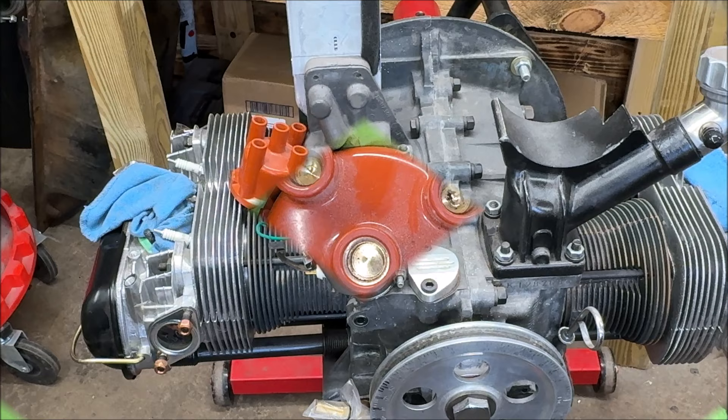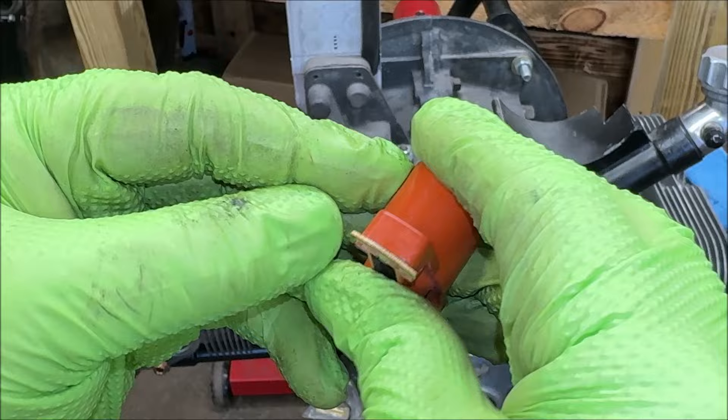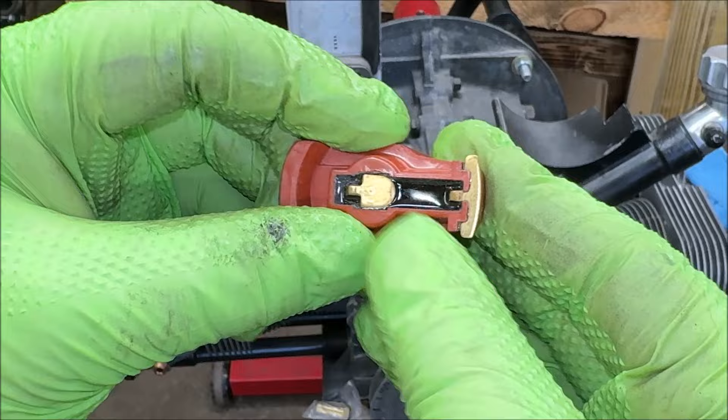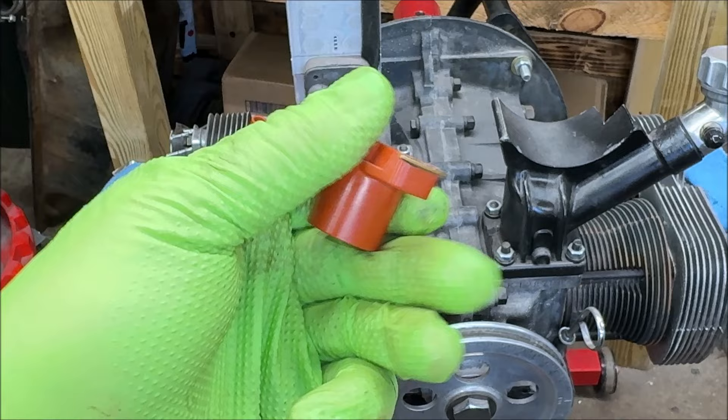Next is your rotor — pull it and check it. A little bit of light sandpaper on the contact there, and clean it up, make it shine. Make sure everything looks good down inside and get those contact points cleaned up. If in fact it looks worn at all, throw it out and put a new one in. Don't waste your time trying to make something right that is wrong.